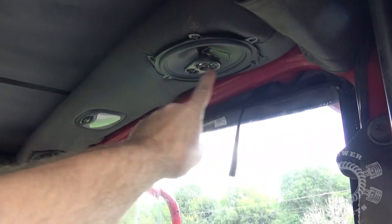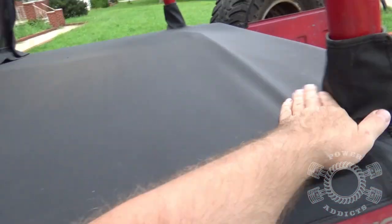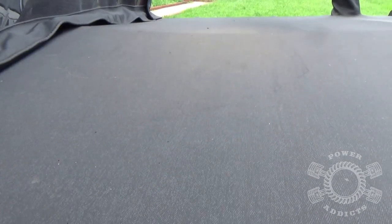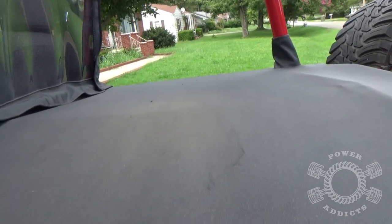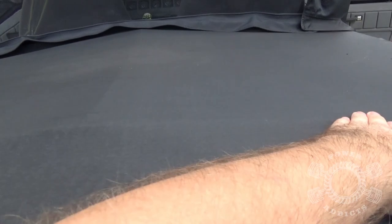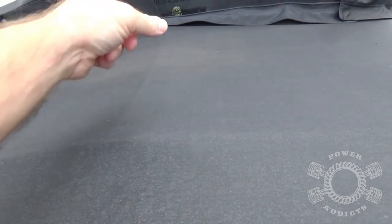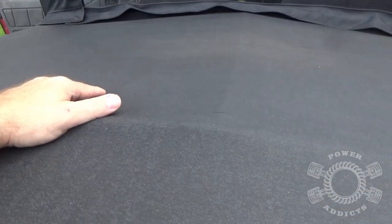But this being such a wide, longer area with no support anywhere through here, I put it up through here thinking it's not going to pull up, but it wasn't going to happen that way because it's still going to pull up right along in here. So I had to come up with something a little bit different. I've created another bow right here, and then I still had this in the middle, so I chopped that one in half, chopped that one in half, put a tee fitting right here, ran another bar across here, and now I've got this nice little roof pitch kind of thing going on here on both sides — water runs off just perfectly now.